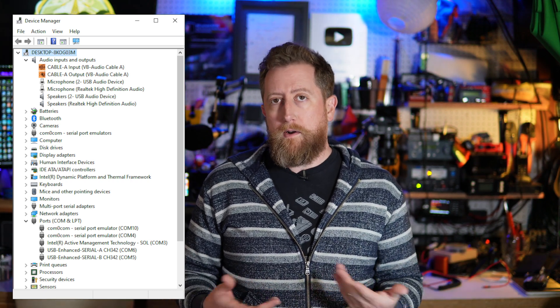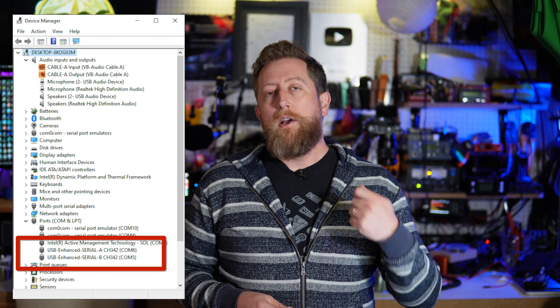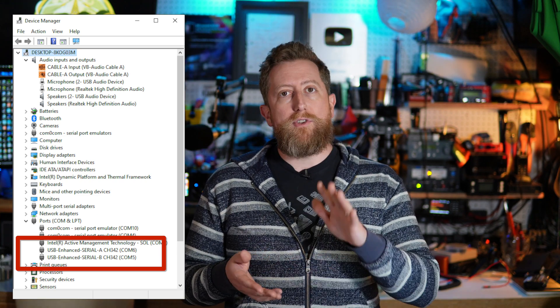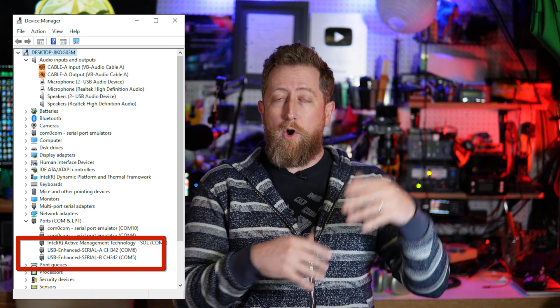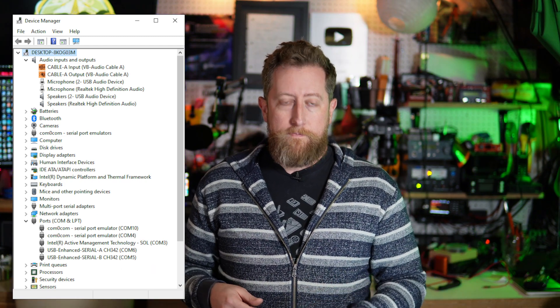Now that you've got your USB connected, bring up your Windows Device Manager. If you're using a Mac or Linux you'll need to go about this another way — you can do an ls on the USB ports for Mac or Linux — but I'm talking through Windows right now since most of you are using Windows. Bring up Device Manager and go to your Ports setting. You should see two new ports. The best way to confirm: unplug your radio and plug it back in. I'll try to link to drivers — a lot of you won't need them, but some will. You need those drivers installed if you're having a problem seeing the ports. When you plug the radio in, you should see two new ports appear. They'll have the same name but one will be a lower number port and the other a higher number port — it will vary on your computer.